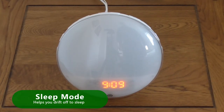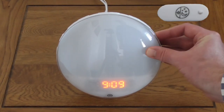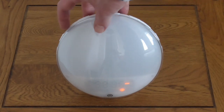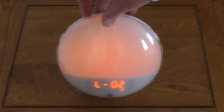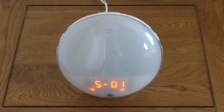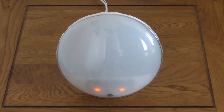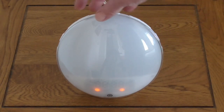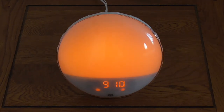The sleep mode function helps you drift off to sleep by playing restful sounds or the radio and gently dimming the sunset light. Press the Sleep Mode button on the right side of the unit for two seconds and set the desired time interval using the Increase and Decrease buttons, then confirm by pressing the Sleep Mode button. Next, set the initial lamp brightness between levels 0 and 20 and confirm. Select the sleep sound by pressing the Increase and Decrease buttons — choose between rainstorm, forest, river or radio. Finally, set the desired volume between levels 1 to 16 and confirm by pressing the Sleep Mode button. To cancel the sunset simulation whilst in progress, press the Sleep Mode button.